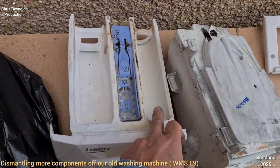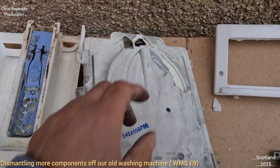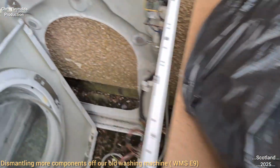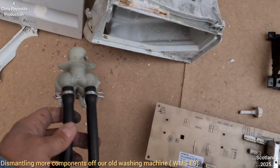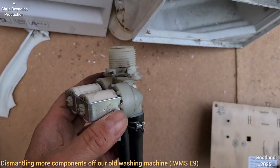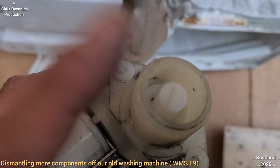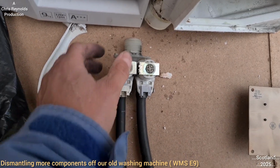Pre-wash powder goes in there, main wash powder goes in there, softener goes in there. Water comes in from the two hoses, solenoids, which are connected to the back of the washing machine. Fits in there. Comes under mains water pressure. It gets energised from the brain of the circuits. The brain here tells them to energise, which causes the solenoid to open, which allows the water to flow through its natural mains water pressure. So it's just mains water pressure force.